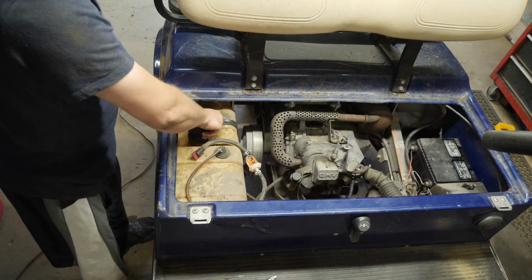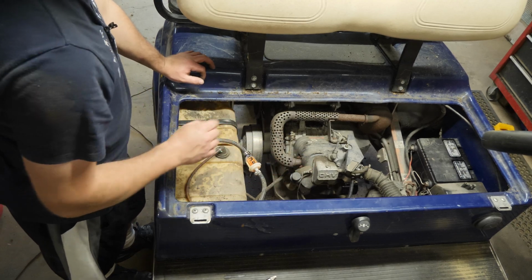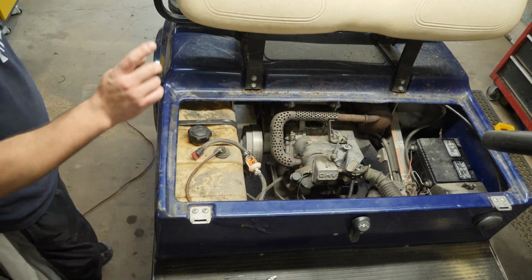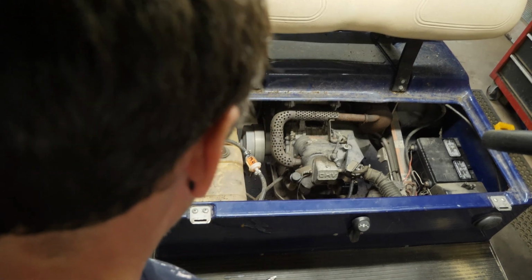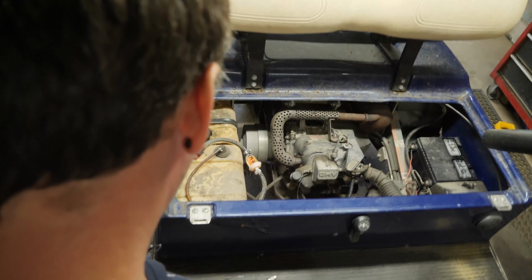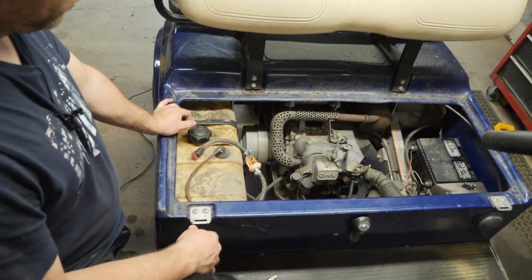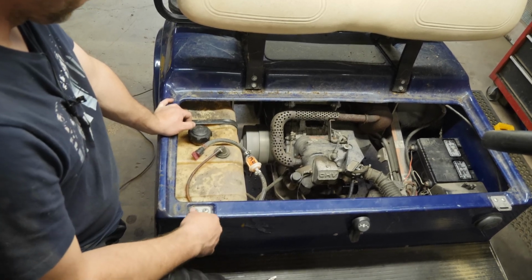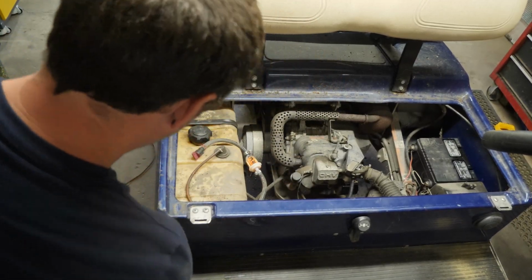Okay, so there we go. There's that. Gas tank is clean. New fuel filters. Replaced a piece of fuel line. Spark plug's good. We did an oil change and a filter. Air filter is good. We still have to replace the battery and do 3 used tires. So let's see how it runs. All right, so I'm just gonna run this for about 10 minutes. Fantastic. Okay, so I know this fuel system is clean.